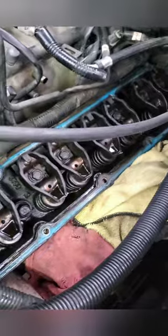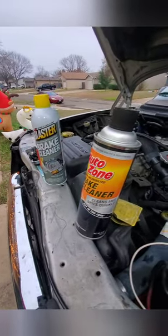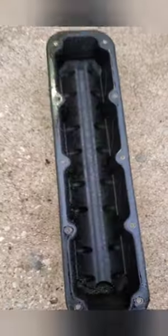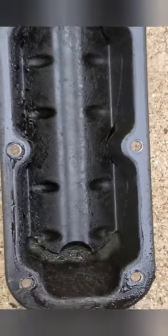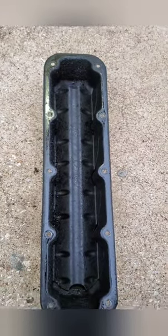As you can see the gasket is pretty old — everything in there is still stock. This is the first time it's ever been opened. I went ahead and vacuumed all the leaves and dirt off this side. I'm using blaster from AutoZone. I covered up where the spark plug goes so no brake cleaner gets on them. I'm doing one side at a time, not trying to rush it. This is how it looks inside the original valve cover — you can see all that carbon, old sluggish oil build-up. Taking all that off.